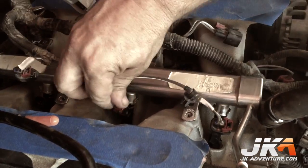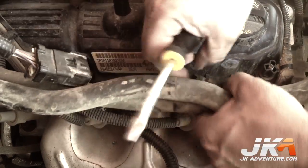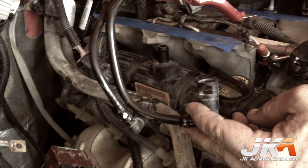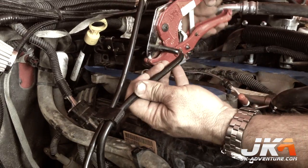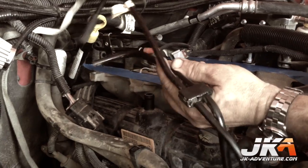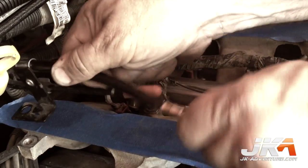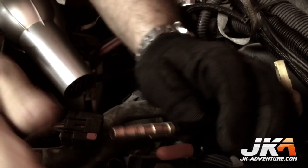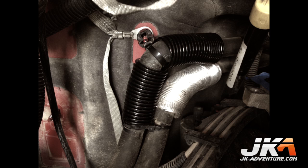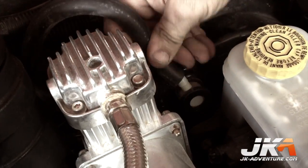Remove the clamps securing the heater hoses on the passenger side of the engine compartment. Cut the existing EVAP tube on the passenger side behind the engine three bends from the EVAP solenoid connector and two inches past that bend. Use a heat gun or hair dryer to heat the bare end of the tube and insert the provided coupling — be very careful as the tube and coupling will get very hot; gloves are a great idea. Place three-inch sections of wire loom over the heater hoses by the firewall to protect them. Here is the hose that you will guide behind the motor next to the firewall and connect to the brake booster.